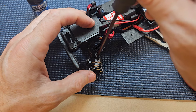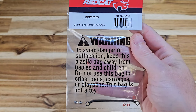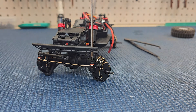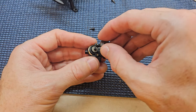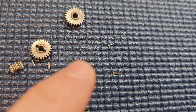One issue we did have is that the two screws on the top and bottom that attach the inner portal cover to the axle kind of bind up with the brass inner portal cover. We ended up using Loctite on each of those screws to tighten them up, then backed the screws off a little bit to minimize stiction in those parts. For the steering link, Red Cat gives you two little o-rings that go over each end of the eyelet to secure it — a really easy swap and install.